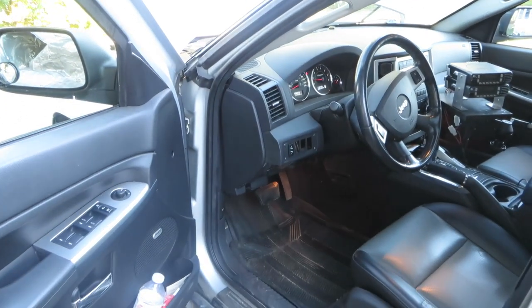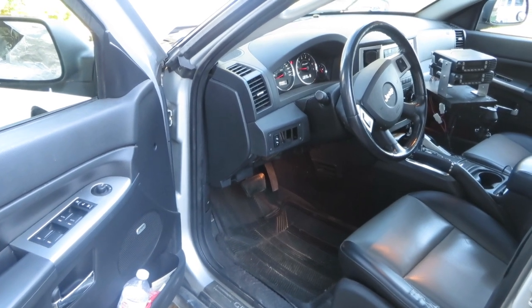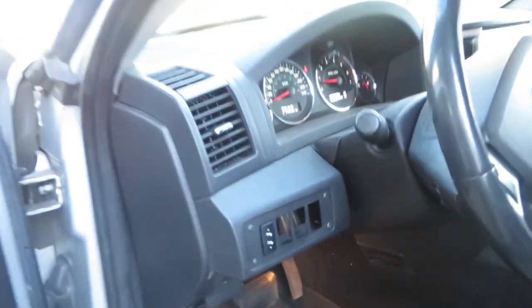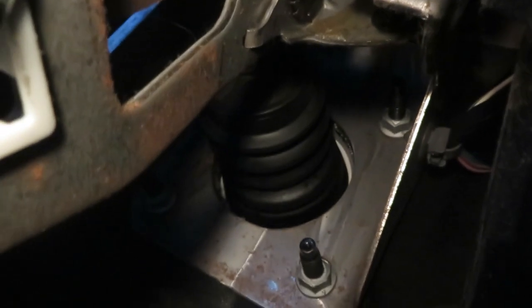We're working on the Jeep again. Right now I've got a problem with the brake booster - it's been leaking. Where it goes through the firewall, here's a spot where it's supposed to breathe through when you take your foot off the brake, but it's been leaking vacuum. You can't stop it - if you push the brakes and let it back out, it starts sucking away again.